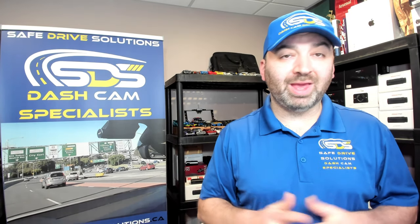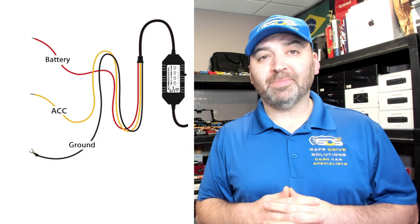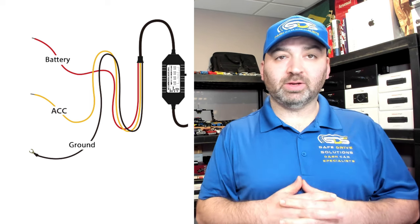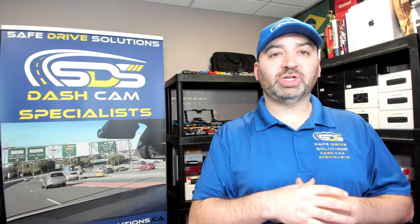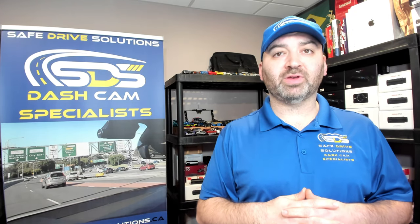Parking mode cable and low battery protection. With the Viofo, you must hook up power, ground, and ignition to the vehicle. You must also use the selector switch on the cable to determine your low battery protection. It has set voltages of 11.8, 12, 12.2, and 12.4 volts. What this means for you is if it drops below those set voltages, the dash camera will shut off in parking mode to protect the battery of the car.